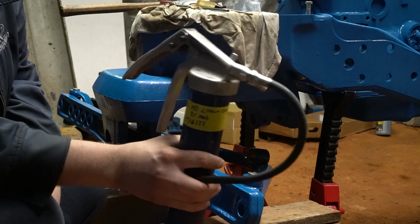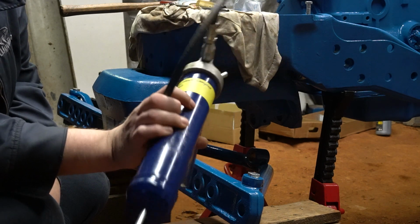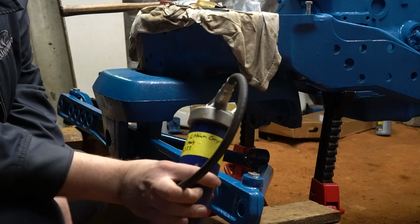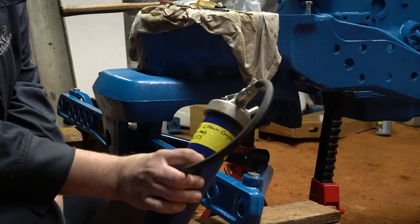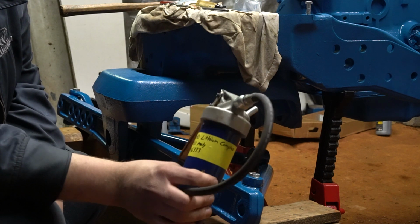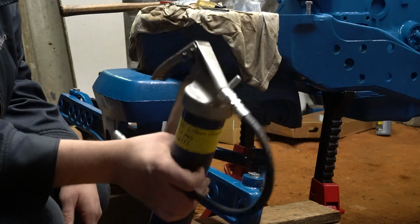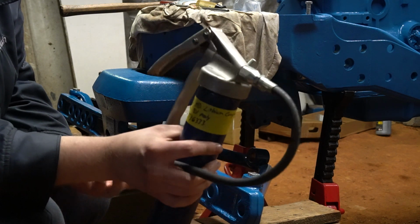The grease that I put in this grease gun is a John Deere lithium grease with 3% moly in it. And I did that because I figured John Deere knows how to make greases that fit their tractors, their spec for their tractors, versus running an off-the-shelf grease. And the reason this is moly grease, John Deere refers to it as a special purpose. This is designed for pins and low-speed applications. Well, all we're doing here is pivoting on pins. So that's what I've got here to go into my axle, and it's also recommended for ball joints. So that's where it's going to go.